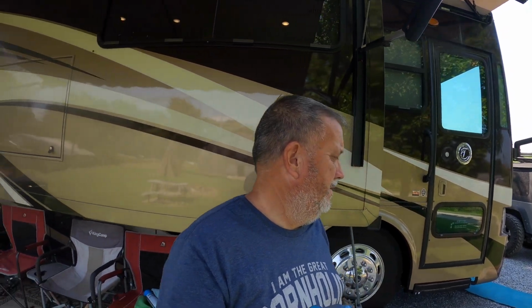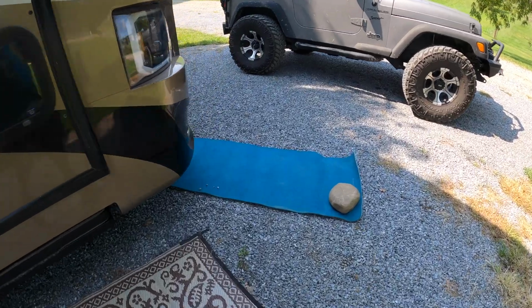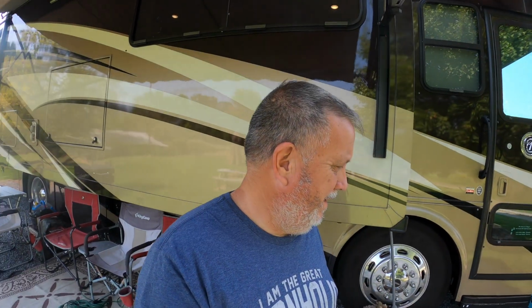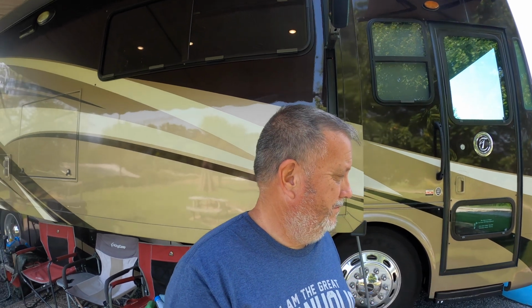Any time that I've ever had an issue where they haven't come all the way up, it is lubricate it, work it a few times, and boom, they're fine for the next 2-3 months. Those things need to be lubricated, like I say, weekly or bi-weekly, and at the very least monthly. One thing too, I might point out, if you ever have to get underneath your coach, go to Walmart and buy one of these yoga mats, a little exercise mat. It rolls up great, it's easy to carry, it's light, and if you're on stone or concrete, you don't have to worry too much about laying in the rocks. It's a little easier on your back.